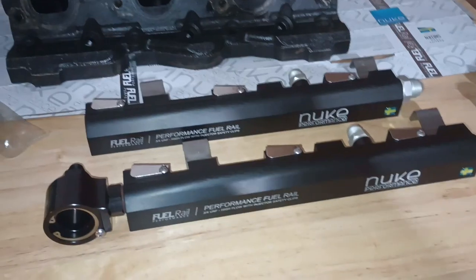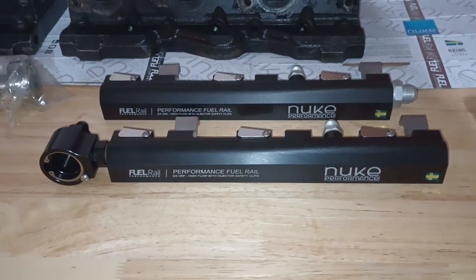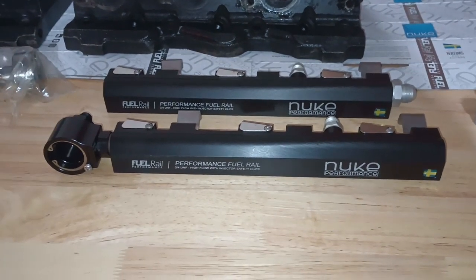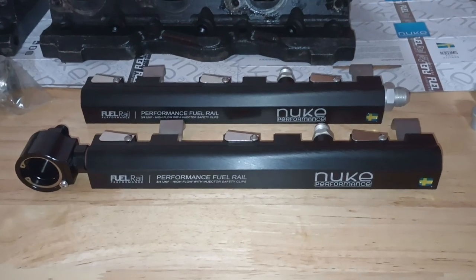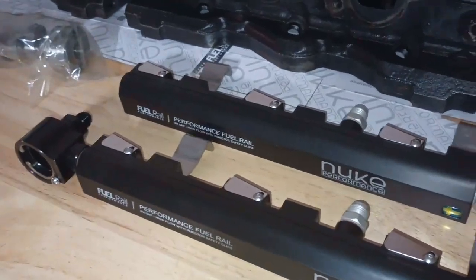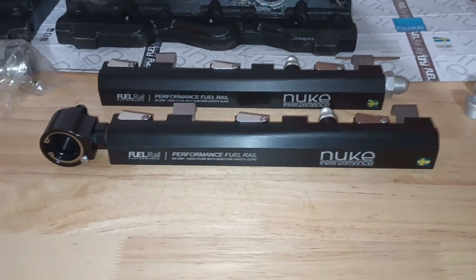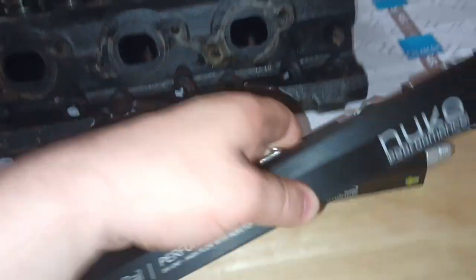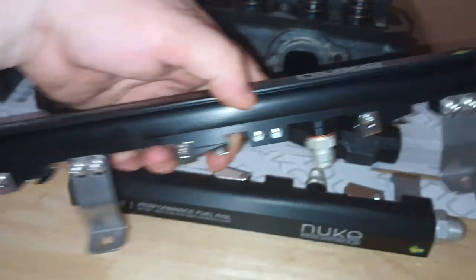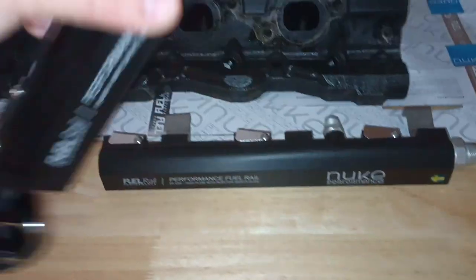A new item on the 3800 market that I just came across — I was searching Google, just put in '3800 fuel rails' thinking I was going to find where some Aeromotive ones were still being sold and what kind of prices the ZZP ones are still out there for, and these ones popped up out of Sweden — Nuke Performance. They have these — I believe they're for the Camaro 3800 naturally aspirated — but we all know the alignment goes back and forth between them and I can make the mounting brackets do whatever they need to do. It's a dash-8 bore through there with ORB fittings on the end, and then it's got a dash-6 on the center line so I can have an option for the return to come out of there.